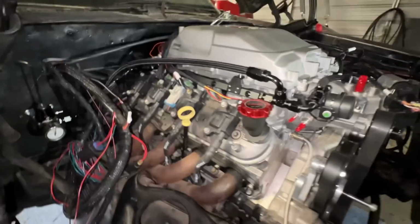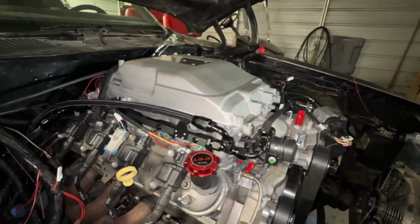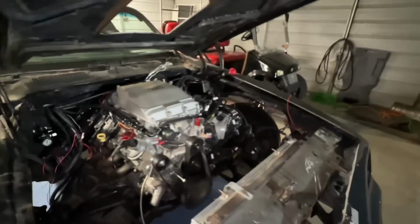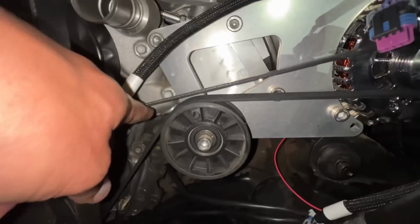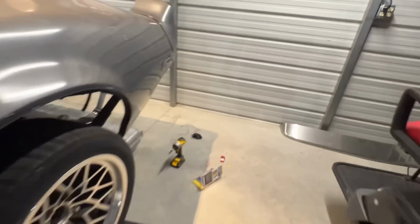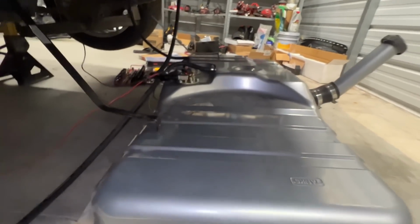They're metal. We didn't have it when we bought the car, but it's just super exciting, guys, to have fuel pressure. That was a big thing. So now that whole fuel rail has pressure, 60 PSI all the way through it, 62. And now it's just a matter of wiring, making sure nothing's touching anything hot. Get our O2 sensor in, and let's check on this bracket I bought, because that tolerance is just a little too close. See that? Get a smaller pulley, or get this bracket on there, but at least get a smaller pulley. But that's exciting, guys. What a quiet pump. Most of these pumps are loud, but all you need is about 58 PSI at the rail for this system.